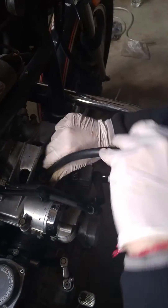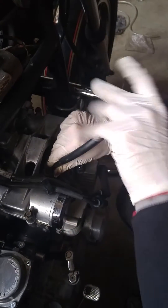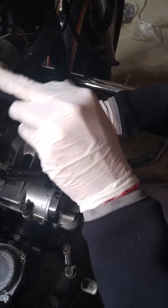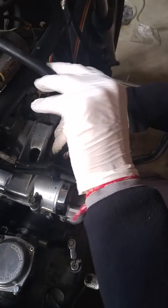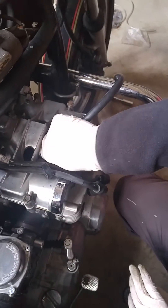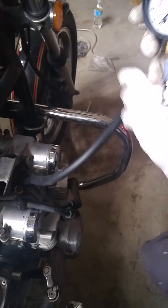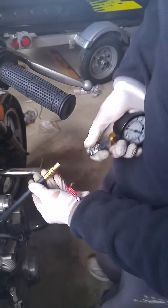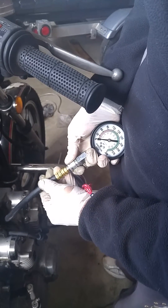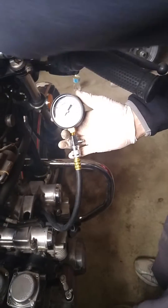With the quick release, you don't want the gauge hanging out making things more difficult than it needs to be. Tighten it about finger tight — you don't want to strip the threading. Just enough to cause a good seal; you don't want any air leaking out of the spark plug hole. Then take the pressure tester, lift it up, slide it in, and make sure it's sealed.